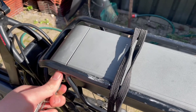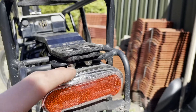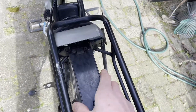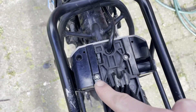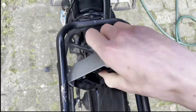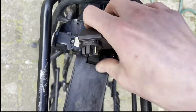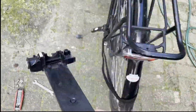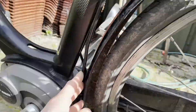Step 1 – The Battery. First you remove the battery and unscrew these two nuts. Then you can turn the battery holder over and loosen these three Torx screws. When the screws are loose, turn it over and you can remove the cover and the battery frame. Then you disassemble the cable and the rest of the frame.